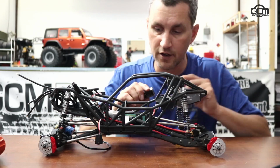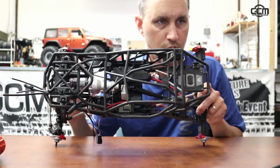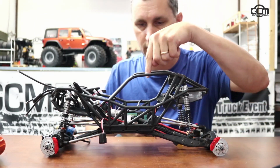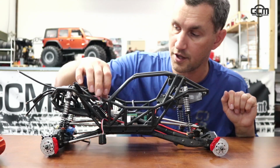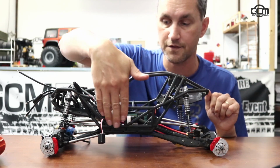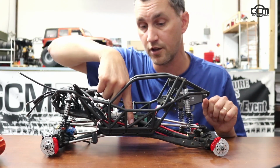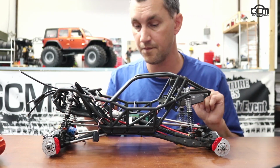So this is very likely going to sit right beside the transfer case on the floor right there. I'm going to put it right there because it's down low. I've got lots of room to put wires. The wires will sit directly on top like this. I can have a seat and a driver cover that completely, so that won't be seen at all. And if I should have to service it for some reason, I can take off the side panel and actually get into the wiring from the side panel. I mean, you can see it sitting right there. So I won't have any problem plugging or unplugging something if I had to, and leave the interior in the vehicle. So that's kind of the plan for that.